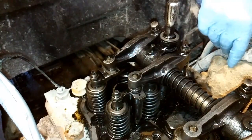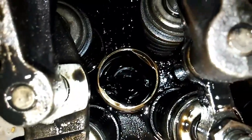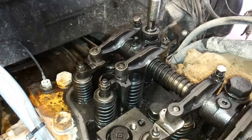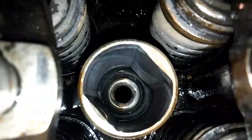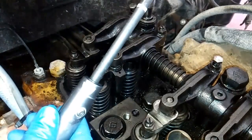Getting on to cleaning your bore — you can see the nozzle bore here is full of oil and carbon. The best way to clean it out is just spray a little brake clean in there. You don't want to fill up the cylinder — just enough to wash the little bit of oil and carbon into the cylinder. You don't really have to evacuate these cylinders after. There'll be very little oil and brake clean that makes it into that cylinder. You can see it's much cleaner now, and our washer wasn't stuck in there — it was on the nozzle.